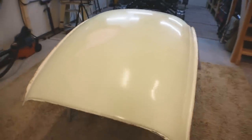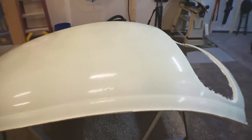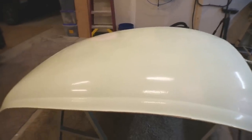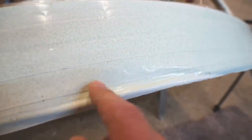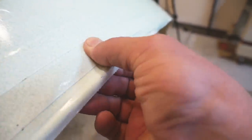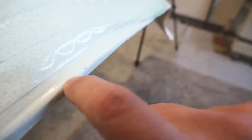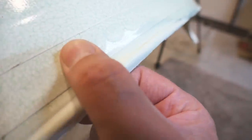The good is that it came off in one piece. It looks pretty good, honestly. It's really lightweight, really thin, and it's got just the right amount of flexibility. If I did this again, I'd probably do three, maybe four layers, but not much more than that. This is right off the mold so I haven't cleaned it up yet. There are some mistakes — there's a wrinkle actually in the fiberglass that's not on the mold; it just ripples right there. But it's not horrific, and this will actually get trimmed right along here. There's a good chance when it bolts onto the chassis it might actually draw it out.